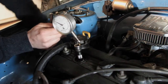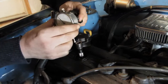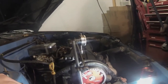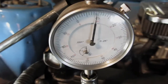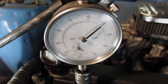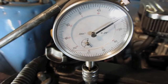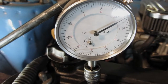The call is for 2 degrees retard on the exhaust side. Retarding the exhaust cam advanced the intake 2 degrees, and now we have 4 degrees of overlap, which will shift the power band back up to the top end.